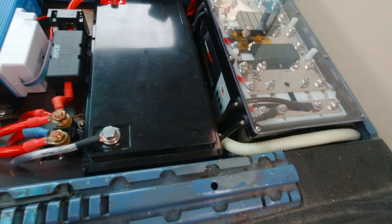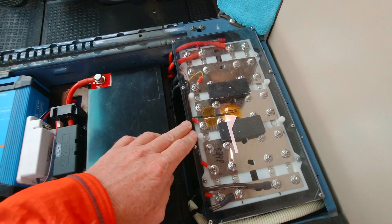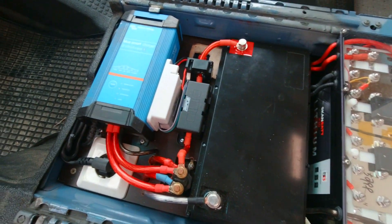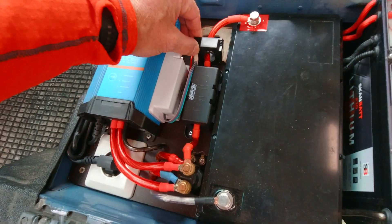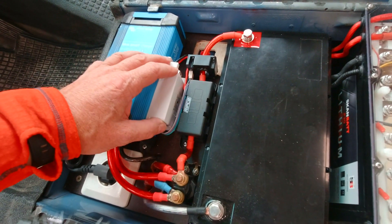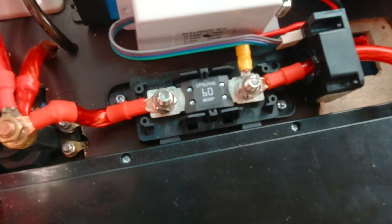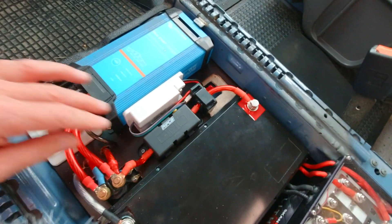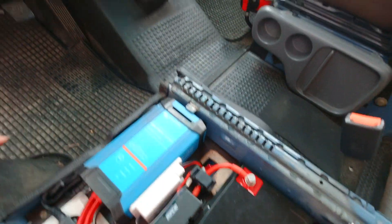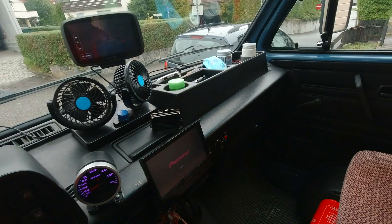So everything is good, but I need to secure it because the battery needs to be secured according to car requirements, so I need to put a strap over here. This is what I call a new-style system — it has a Hall element inside, so you don't need a shunt resistor like on my old system. Inside here is just a fuse — it's a 60-amp blade fuse. And this is the receiver for the Hall element, and this is also Bluetooth up to this unit. I will show you that one as well — put in the key and then it should kick in.